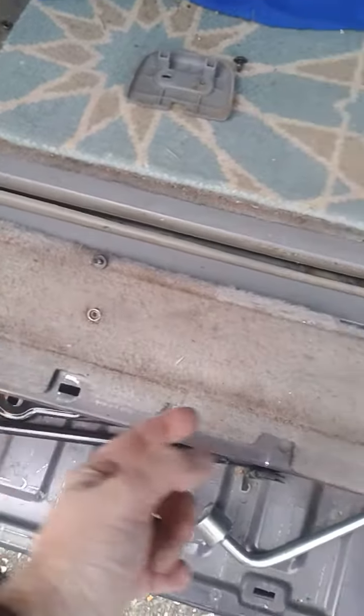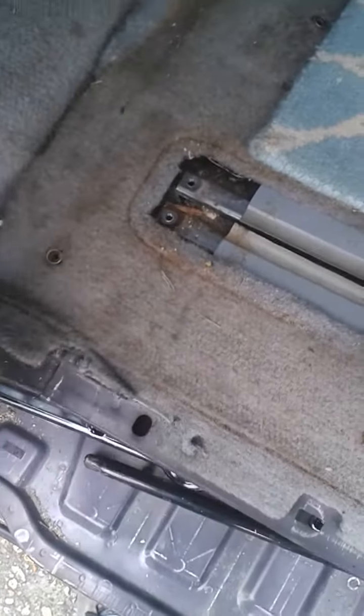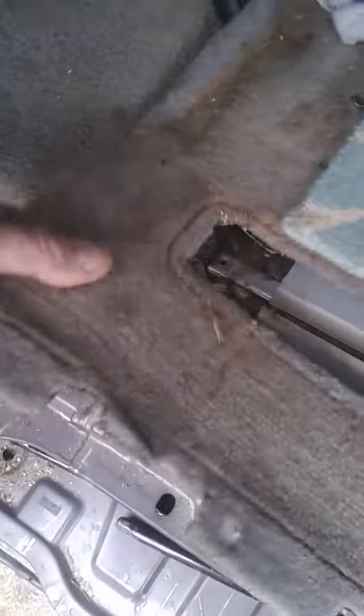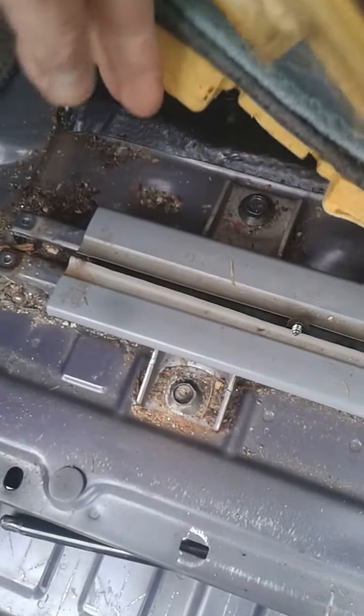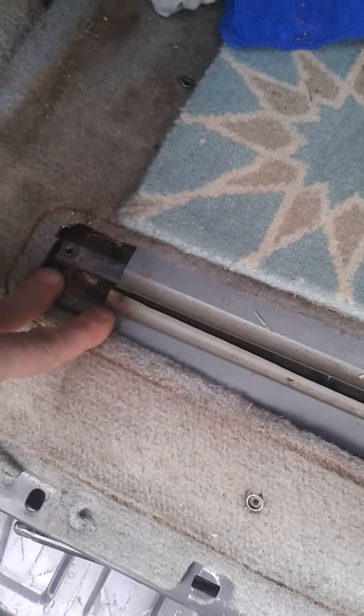Pull the trim pins around the box in the doorway, take the plate off there, two cross-head screws to cover it, pull the carpet back and you'll notice that there's a sequence of captive nuts — bolts going into captive nuts. Simply undo those, lift the rail out, and then sort out something to fill in the gap so there's not a great big gaping hole in the floor.